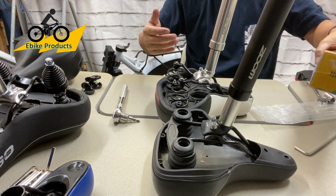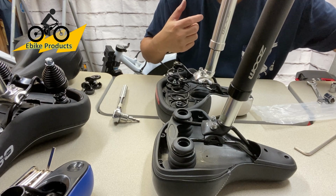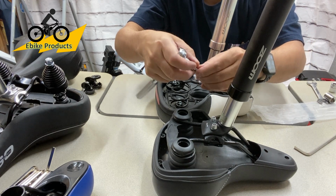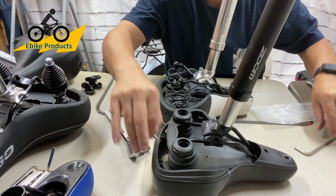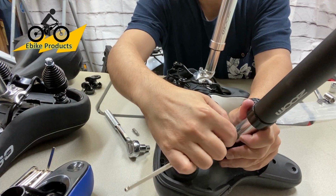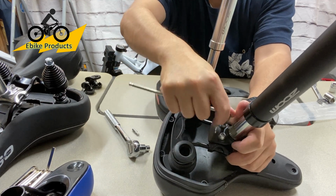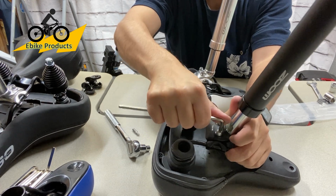Throughout the bike, you will see that there are Newton meter readings on screws, and that's so that you don't accidentally over tighten and strip something. Like a seat post, this is a $30 seat post that can be replaced pretty easily. But if you strip something that's on the frame of the bike, that can be really, really devastating, because you won't be able to fix that. So right now, I'm just going to say, if you have a torque wrench, by all means, try to go up to 10 Newton meters. I kind of already have a feeling what it's like.